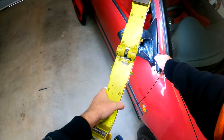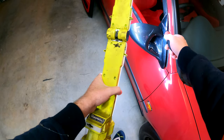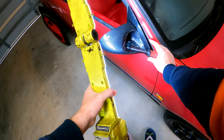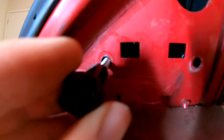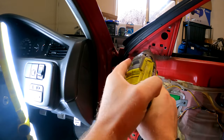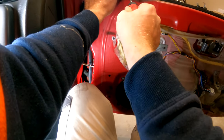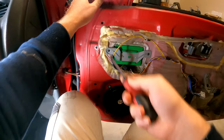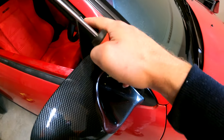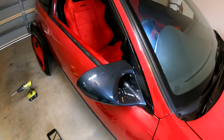Okay so it looks like the mirror doesn't line up with the holes that great. I might have to just elongate the holes in the side of the door so I can rotate — I want to rotate this up a bit more. You might be able to see the hole is slightly offset. That looks much better. The gap around here is actually even now — that looks alright.